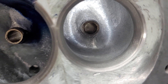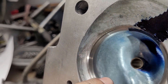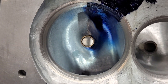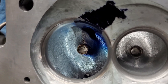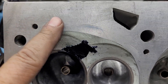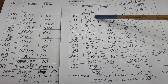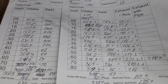Did it help? Well let's take a look. I see a spot I forgot — I forgot to work on blending this in on this whole side, the lower cut into the throat, and I guarantee that hurt us. Originally it was basically a radius and it wasn't even straight because I couldn't get the valve to seal. The flows you're going to see have much less leakage — they're not perfect, I still need to put tape on this for a better seal, but they're much closer to being accurate than they were. Our 0.05 is too high — it was too high before, it's still too high — but I'm willing to bet this is flowing better than that leaky one.